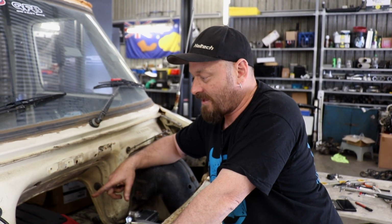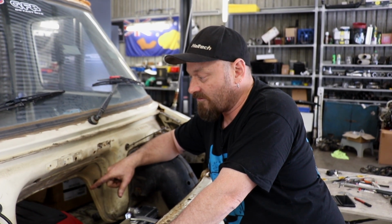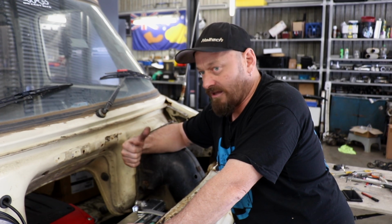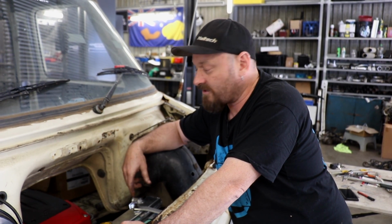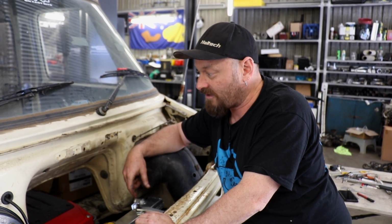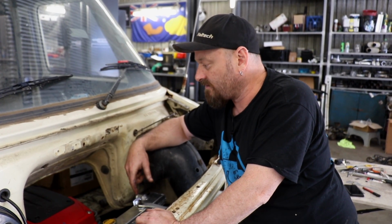I've got a 3-inch donut with a tight radius bend that we can chop up and use to make most of the dump pipe. And I've got another stray 90-degree bend left over. After that, we'll have to wait until the piping that I've ordered comes, and the muffler and cat and that sort of thing. So we'll just make the dump pipe for now so we can move on and finish the rest of the intercooler piping and the oil drains and that sort of thing, and the wastegate outlet on that side. So we'll get into that.